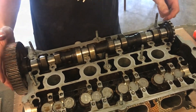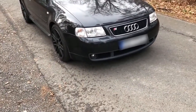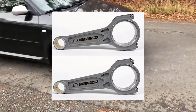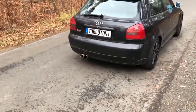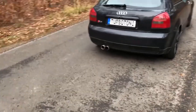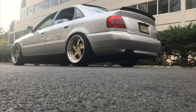When it comes to building your pistons and rods for power, different power levels require specific upgrades. For power levels between 300 and 400 horsepower, upgrading the connecting rods with forged options while retaining stock pistons is a proven and reliable combination. Most H-beam rods should be fine — just remember, normally the expensive brands are expensive for a reason. Note that stock pistons and rods can handle around 350 horsepower, but you are pushing them pretty hard at that point.